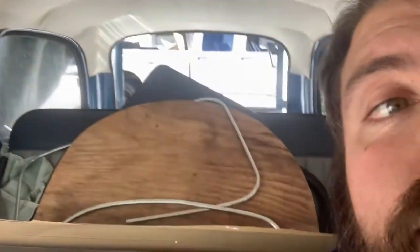Sender in, pickup is in, everything is in, back there underneath. Anyway, checking for voltage, we don't have any on either wire, even when we have a good solid ground. So when you turn the key, when everything's hooked up, the fuel level on the gauge cluster goes immediately all the way to the top. So I'm gonna pull the cluster out and start chasing power from the back to the cluster.